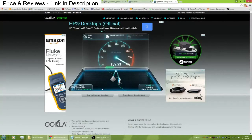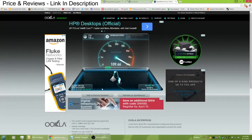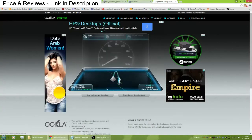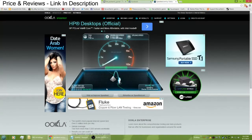Lastly for our wired test, we analyzed the Netgear Nighthawk AC1900 D7000 router. This test went very well — my ping was low, on average 10 milliseconds, and download speeds were pushing 100% capacity, providing me with 110 megabits per second. Upload speeds were the same as the direct connection to the modem. This is what you should expect from a good wired connection from your router. The Nighthawk has four gigabit ports, meaning it will provide you with up to 1 gigabit per second speed. Conversely, the WNDR 3300 has a 10-100 megabit port, which used to provide close to 100 megabits per second but has been bringing lower speeds as of late.